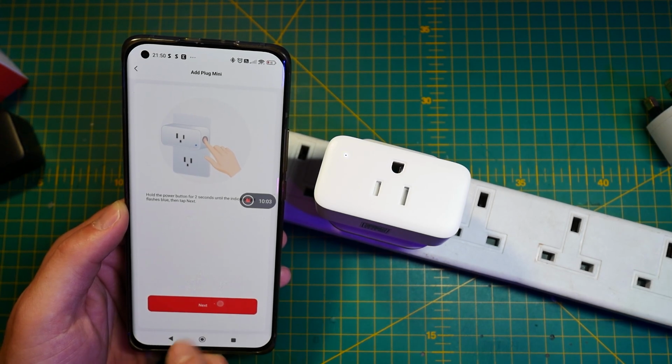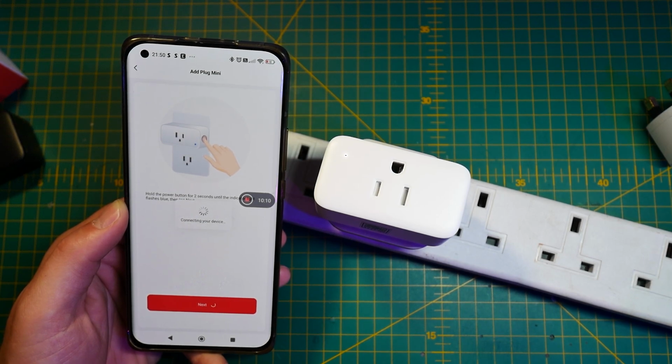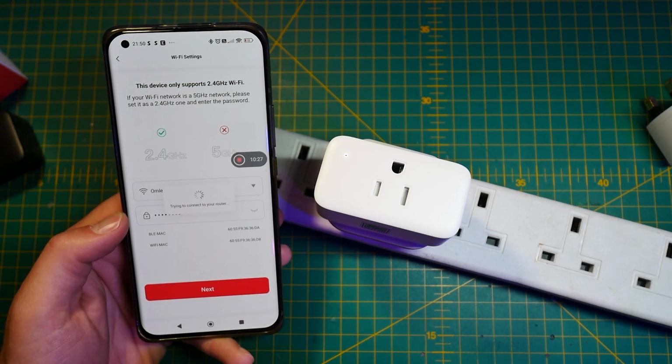I'm a big fan of Bluetooth because SwitchBot makes it super easy to connect to everything in their ecosystem, and you don't actually have to use Wi-Fi to steer their devices. You can do it directly over Bluetooth if you don't want to connect it to a cloud. But this has Wi-Fi, 2.4 GHz to be precise, and will connect to your local network, and you don't need a hub to add it to your SwitchBot cloud. Friends on the other side of the pond that are also iPhone fans won't be disappointed because SwitchBot has these tiny little stickers which indicate HomeKit support.